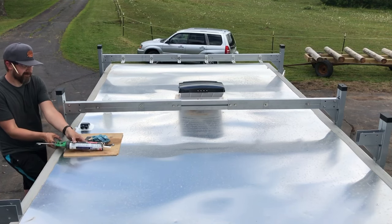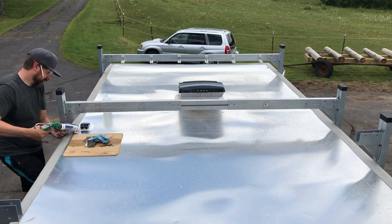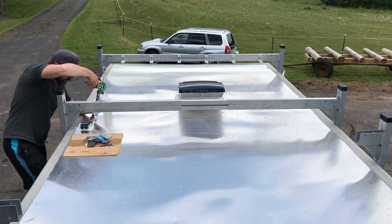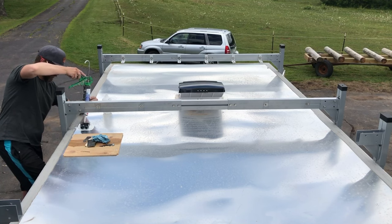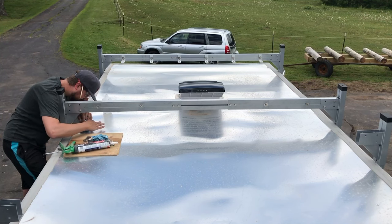And here I am installing the gland already, like an idiot. You wouldn't know that I've done three van builds already because this is kind of a newbie mistake. The gland should go on later. Ideally, you'd put the solar panels down, run the wires through, then put the gland down, and then seal that up. Now what I've set myself up for is I'm going to have to somehow fish that wire through the gland into the top of the trailer through a three-quarter inch hole that I can't see. But I do know — coming from the future — it works out just fine. Do yourself a favor and learn from my mistakes.